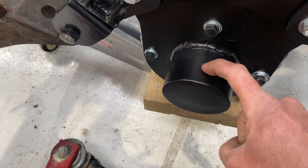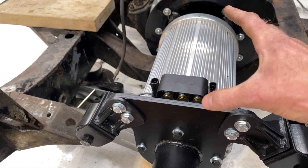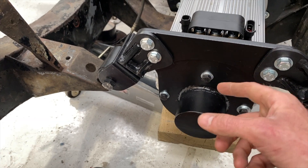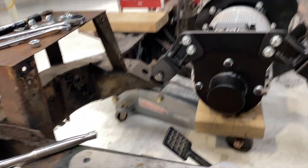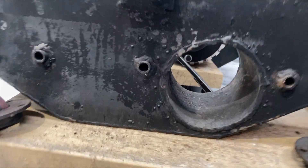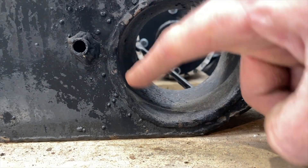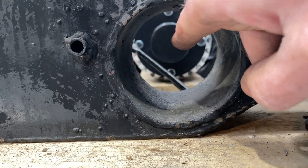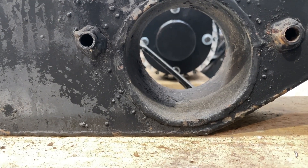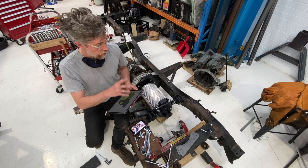Making sure any force and tension is always accounted for — this is really over-engineered for the job. You can see this little capping: there's a second shaft out the front, which allows you to in some cases couple two of these motors together to get twice the power, or run belt-driven accessories off this front shaft. An interesting thing is that because original Land Rovers had a power takeoff at the front and the ability to hand-crank the engine, you can actually align the motor through the original PTO hole. We have a little tool that gets a rod through there, so we can achieve perfect alignment of the electric motor shaft through to the gearbox and out the other side — getting everything perfectly level.